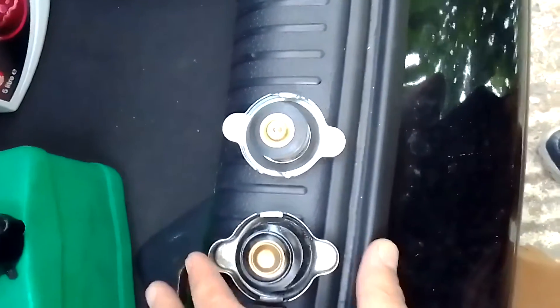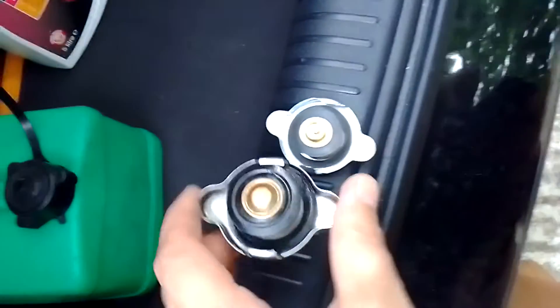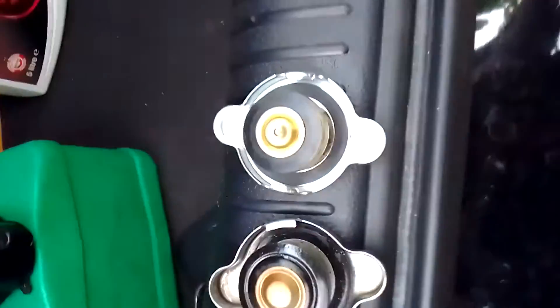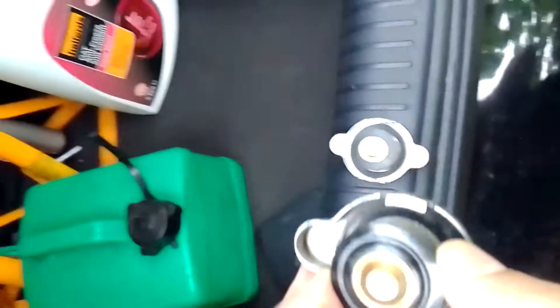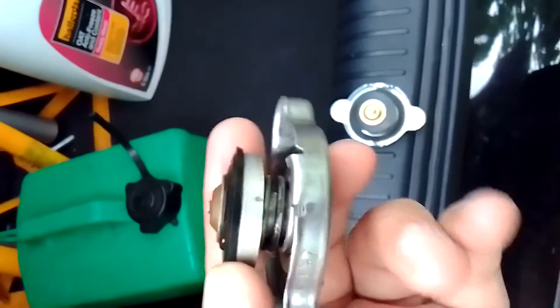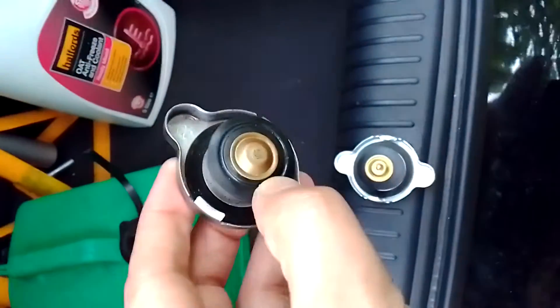This is the high-end A1.1 from 2005. This is an old radiator cap. You can see where the water has dented it in, and it's actually larger than the new cap I'm going to put on. It's very important that you replace this cap — you can see the rubber stretching and drooping over the sides, no longer able to contain the coolant. It doesn't do its job, and you lose coolant that way.